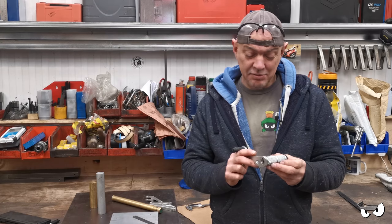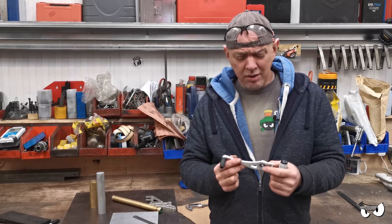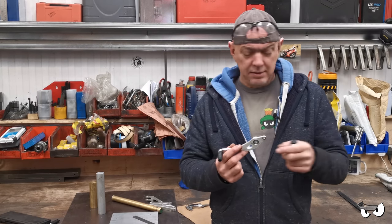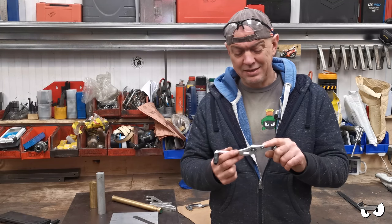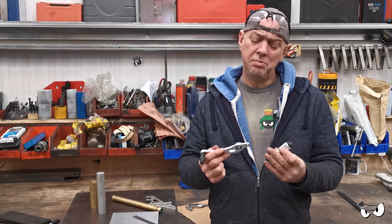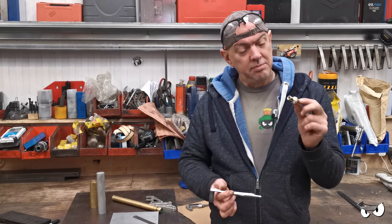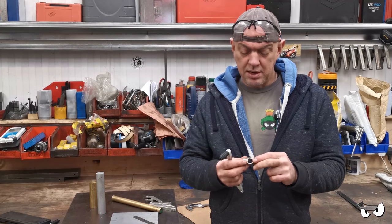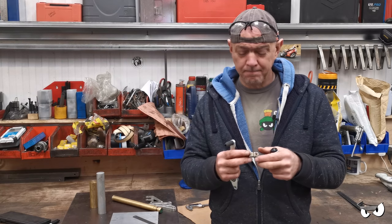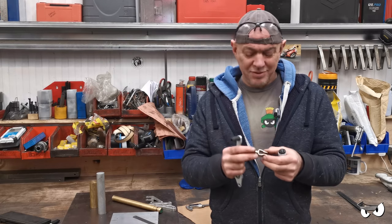Then I need a lever that goes on there, and it's gonna have a brass bushing either side of it as well. And that little pull thingy that goes onto the brake master cylinder, that's in the wrong place. That needs to come up 45-ish degrees maybe. I don't know, something like that. And I'm also gonna need to remake that little brackety jobby. This is what screws onto the thread that comes out the bottom of the master cylinder. Trouble is, I want it at 90 degrees.